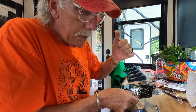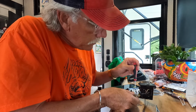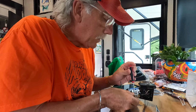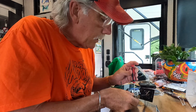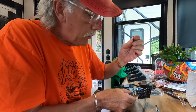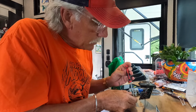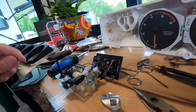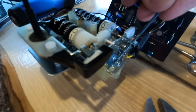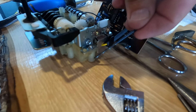Kind of got to push that little nut they give you up in the hole. And this screw will screw down on it, we hope. Yep, there we go. And it draws that little collar up into the hole here. I'll show you what it looks like. See right here? That little screw right there. Because you got this new bolt and shaft for the new gear there, and the other screw won't fit, so they give you this one. The little nut goes up into there.